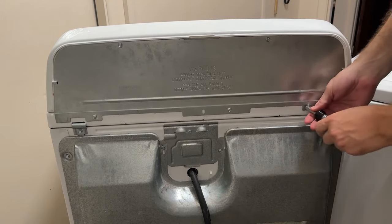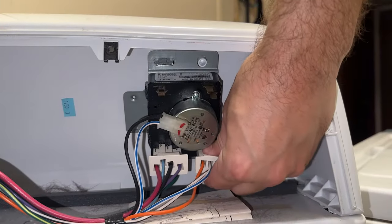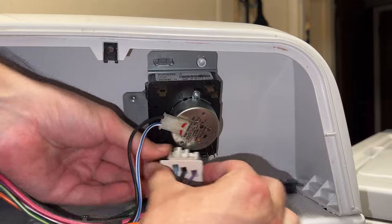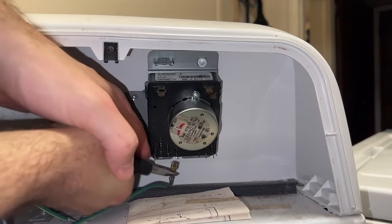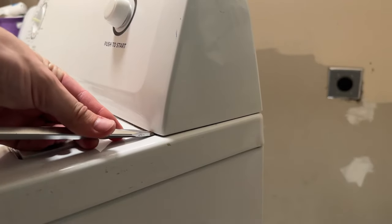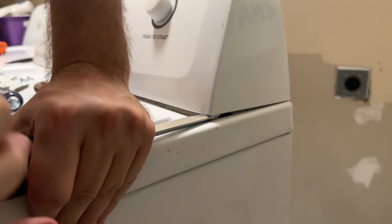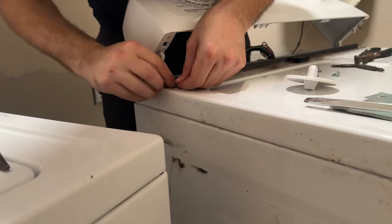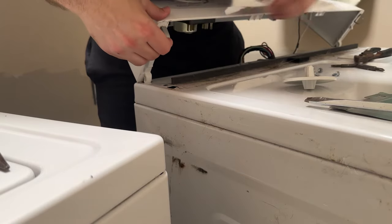I disconnected power and decided to start messing around behind the control panel. You just take these screws out and the back cover comes right off. Seeing as how everything else had been replaced, I had a feeling my beef was with the timer. I started by disconnecting the two plugs at the bottom. I needed a screwdriver for the plug with the blue and black wires and a pair of pliers to reach the ground at the bottom. I also removed the knob from the front. Next I separated the control panel from the top of the dryer by inserting a flathead screwdriver at the edge and pounding on it firmly with my hand until I felt it release — there's a spring-loaded mechanism that holds it together. The spring on one side almost got away from me, but I was able to snap it back into the bottom of the control panel.